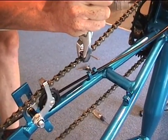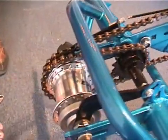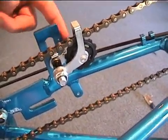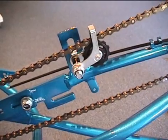You can tighten the 2 pieces of chain together using a pair of pliers or a chain tool if you own one. Wrapping the chain around the back, around the front, and finally making sure you get it through the pulley wheel assembly. This will be used for final chain adjustment when you're finished.